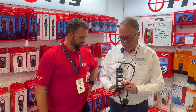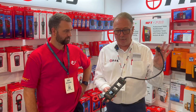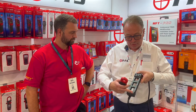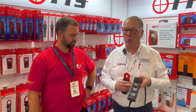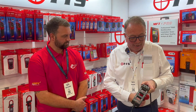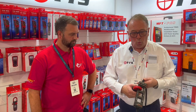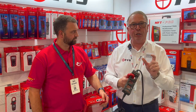The line splitter allows you to basically plug the unit into the wall, plug an appliance into that end, and then we split all the different denominations of the cable feeding an appliance so that firstly, if we wanted to, we could check what currently the appliance is running at. We could also check what is disappearing down the earth. But most importantly for earth leakage, we can clamp around where we split the live and the neutral. That will give us the accurate earth leakage value.